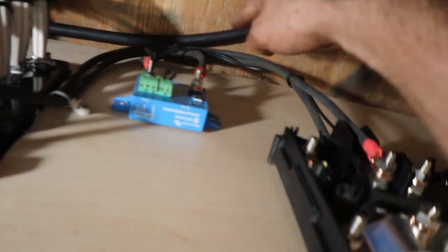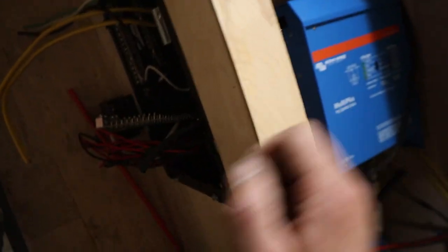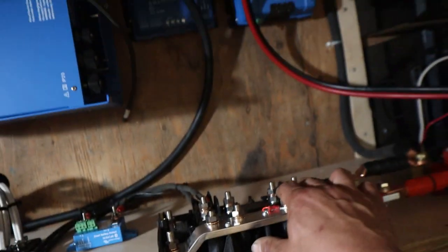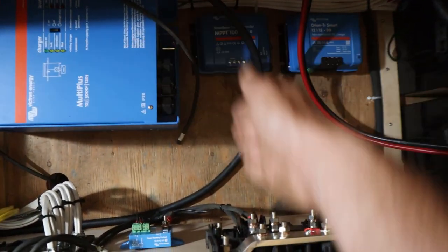The next system component is in. I'm going to show you what the DC protect looks like — it simply goes from the links to a DC protect over into the AC-DC panel where it's going to power all the DC loads. The point of it is it has a low voltage sensor so that if the batteries ever go too low, it's going to automatically cut off the DC circuits to protect the batteries from draining too low. We've got our positive and negatives coming over into our protect inside-outside, up and over, and then it comes right over here into our panel. Next up is the alternator charger, then maybe the MPPT, then the inverter.